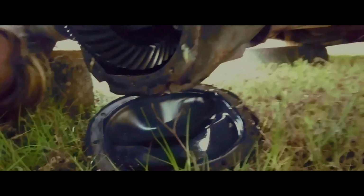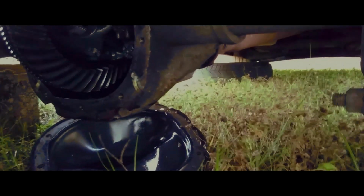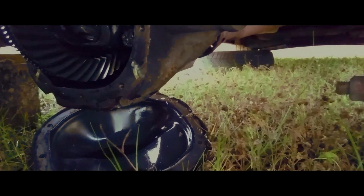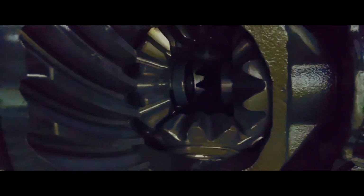From there, we want to turn it back around so that we can see it again. Now we can safely remove the axle piece that's left. Because generally you would push on the axle and this thing will pop forward. Right in there. And there's a C-clip around this, which will yank out.